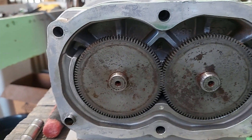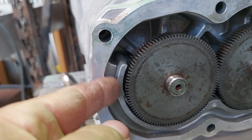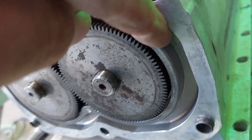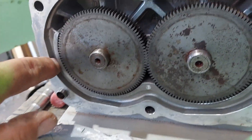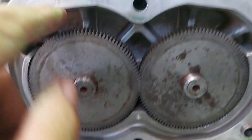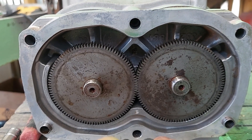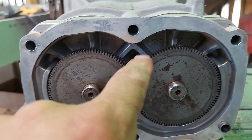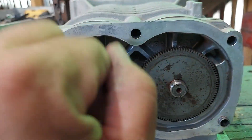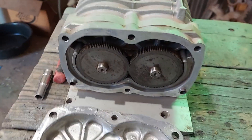What I had to do on that other supercharger was take a little rotary grinder and cut this entire wall off — hit it at an angle with the disc and go all the way around and cut the whole thing off. That way you get lubrication all the way down since the supercharger is flipped upside down. I've seen people run these superchargers upside down without doing that, but I imagine they ran into failures later on. So if you're going to run a supercharger upside down and it has this oil slinger wall, you're going to need to cut it off.